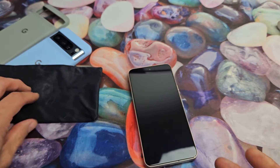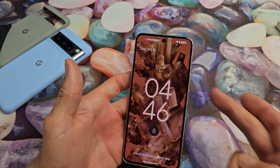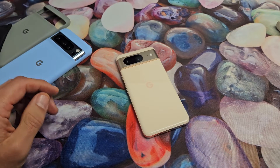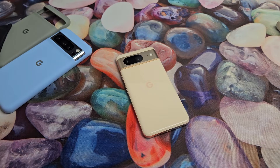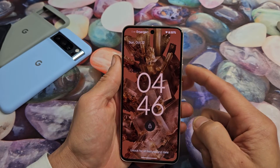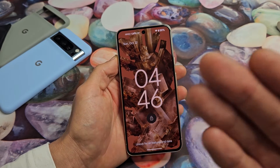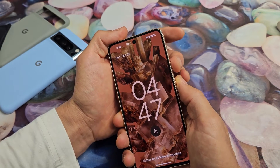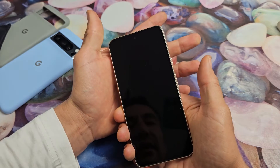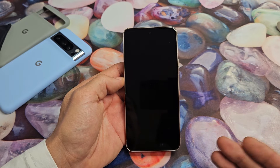So next step — you still have a black screen after doing all those steps. The next method is what I call the freezer method. Grab your phone just like this, nice and naked, and put it into the freezer. Leave it there for 15 to 20 minutes. After 15 to 20 minutes, grab your nice cold phone. Tap on that power button and see if the screen is on. If it's not on, no problem — while it's nice and cold, do the same thing again: press and hold power button and volume up, press and hold both buttons, count to 20 seconds, let go, wait for the Google logo to show up. Then once the phone boots up, hopefully you are out of the black screen.